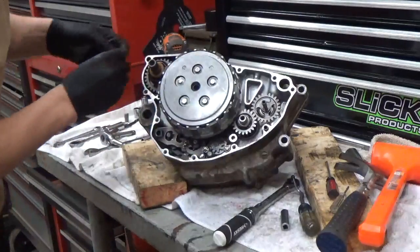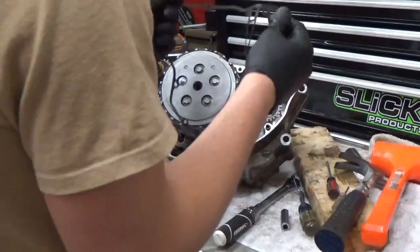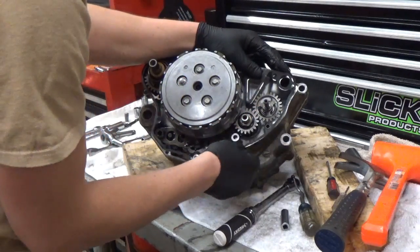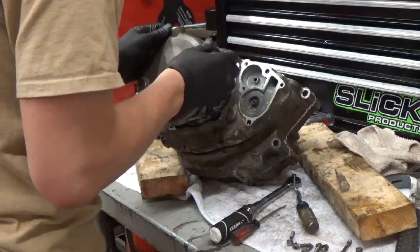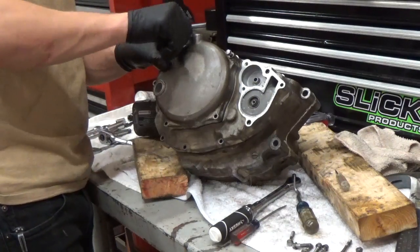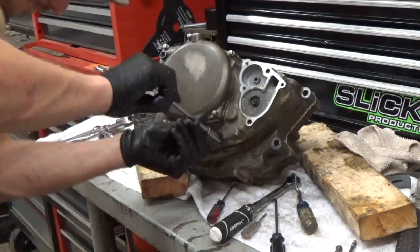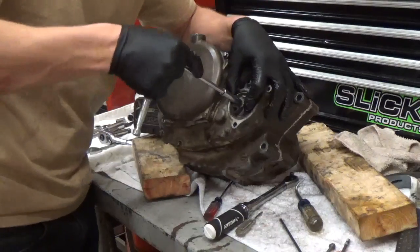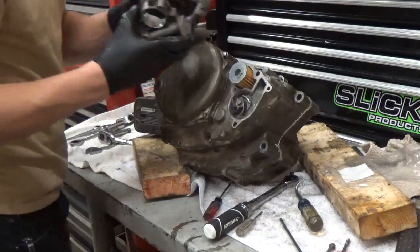Next I'm going to install my dowel pins. I already have my water pump gear installed. Then I'm going to install my gasket and put those on the dowel pins to secure it. Then put the side cover on and lightly tap it on. Then install the clutch cover with the gasket already on, install the two bolts to hold the clutch cover on, and secure the side cover to the case. I'll hand-tighten all the bolts. After that I'll install the water pump — there's a washer on the other side so make sure you install that too. Then install your oil filter.